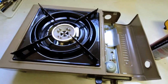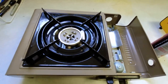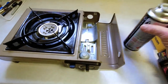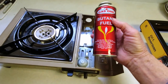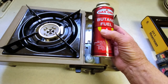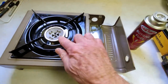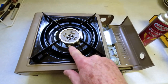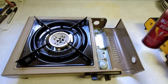Some of the newer ones have a piece of metal that takes the heat from the burner here and supplies it down to this area to keep this bottle warm. Because when this bottle gets low and it gets really cold, instead of having a nice bright flame to the very end, you get this little tiny flame that's good for nothing but maybe simmering. So what they did on the newer stoves is they installed some metal to transfer some heat down here to keep this bottle warm. And that's what I did on this stove.